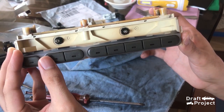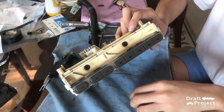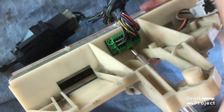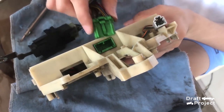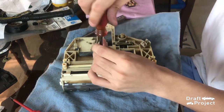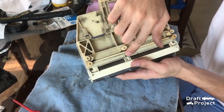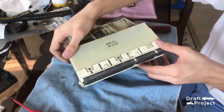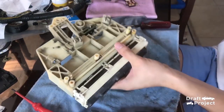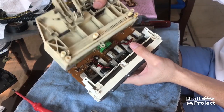Here are the 2 original bulbs and I will remove them. In order to gain access inside the circuit board, I need to remove the housing. I disconnected the plugs of the thermostat, fan selector, and the plug for the main harness. I remove it using a flat head screwdriver — push the lock and pull the socket away. Remove the screw and pull the locking tabs of the housing. There are many locks to consider, so grab a flat head screwdriver to help. Pull it and here is the circuit board.